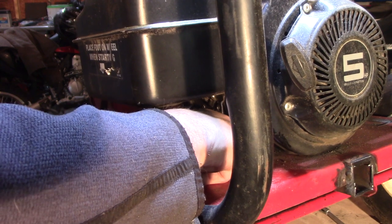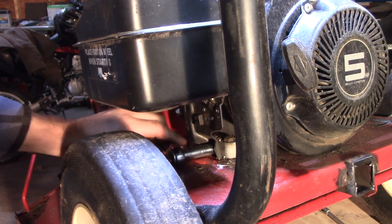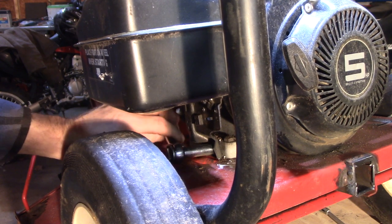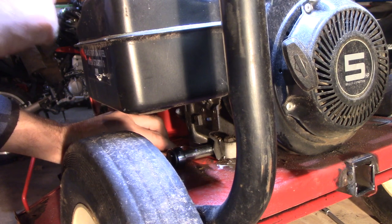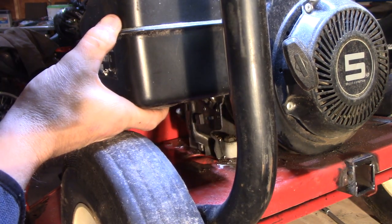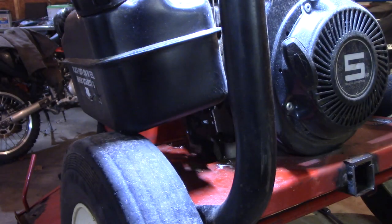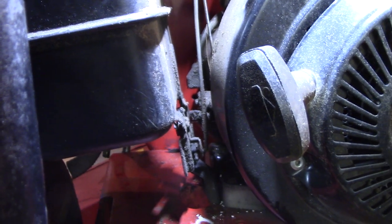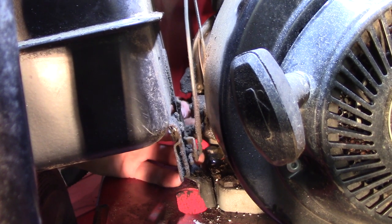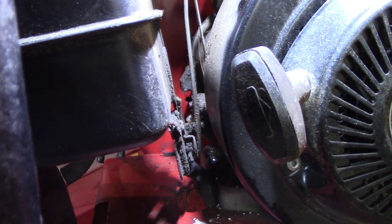It's coming loose, I can see it's dropping. There is one other link that might be holding the thing up — it's the tube going from your carburetor to your valve cover, but usually that just comes right off, it's just rubber. That bolt's out. Now we should be able to get this thing off. There does look like a spring in there. Let me get a pair of pliers — that just comes off the edge.